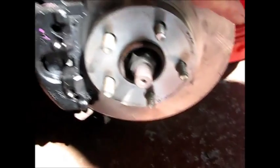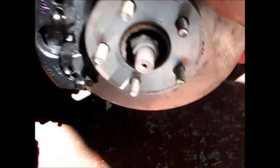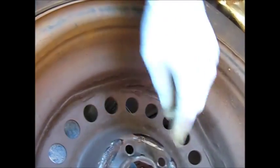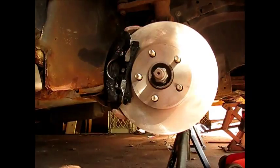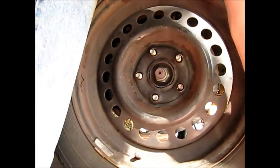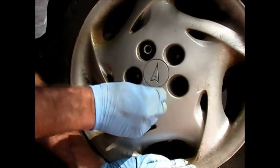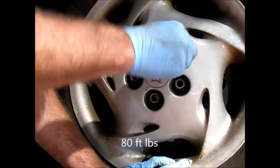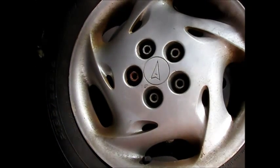Go ahead and push the brake pedal down — okay, we're testing it. You can release it. Making sure it releases. This is good. I highly recommend putting some grease on the inside of the wheel where it contacts the hub for the rotor, because it can rust. This particular car does have regular steel wheels. Let's torque these up in stages, ending up at 80 foot-pounds. That'll do it. Thanks for watching this video.